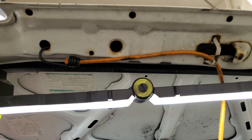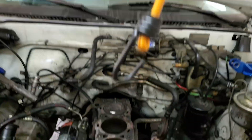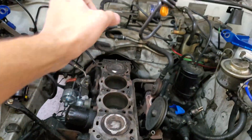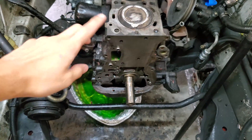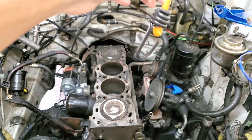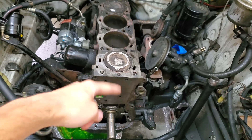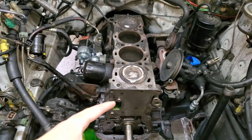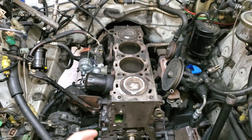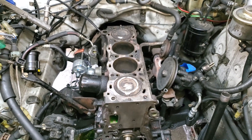To get started we actually need a bungee cord, which is going to hold up the timing gear and keep the chain tension down. We'll put the gear on the end of the bungee cord once we get everything routed up with the tensioner in place. This will keep the gear up and out of the way so that when we slot the timing cover in and put the head on, nothing will be slack and the install will be much easier.